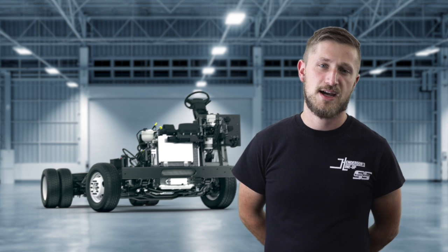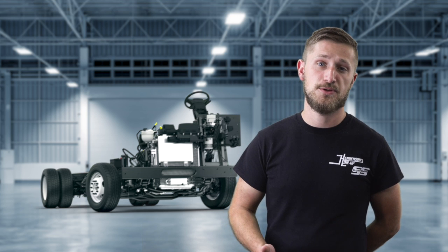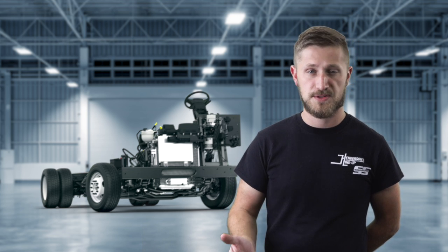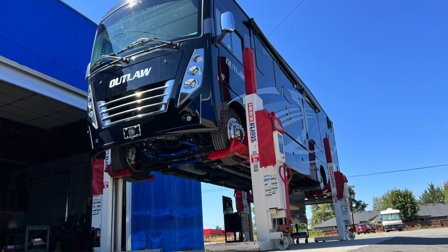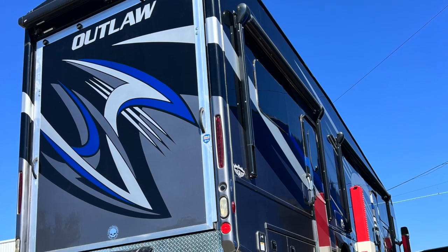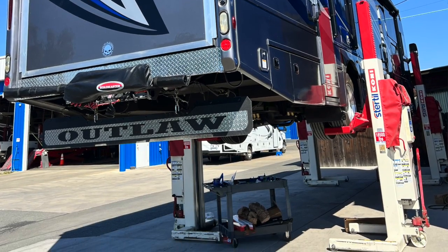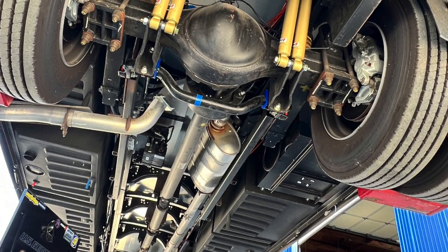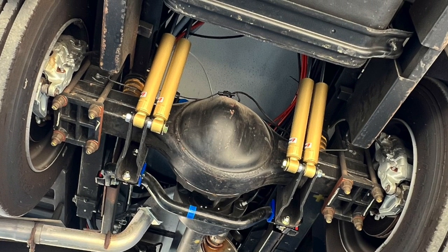The same is true for the V8 chassis — if you've got a 16 or 18K, we'd probably recommend you stick with the factory 2-inch bar in the front. One thing to note on V8: we can still do the rear auxiliary bars in most cases. The exception is the toy haulers, though. If you've got one of the Thor toy hauler motorhomes on the new V8 chassis, the SS218 is really the only anti-sway bar upgrade you can do, because the rear auxiliary Roadmaster bars just don't fit.